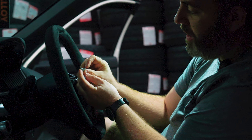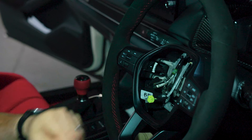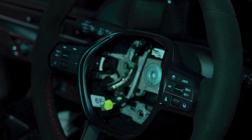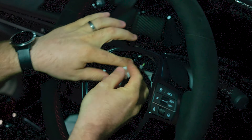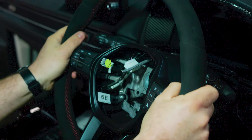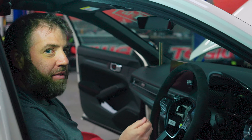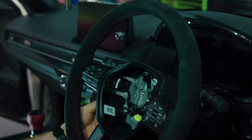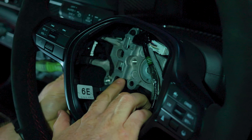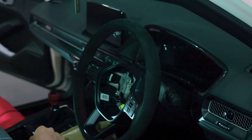We'll set the airbag down face side up. To get the airbag connector off you've just got to pull these little white tabs up and it'll come out. Inside we have a big Allen key or hex bolt and then the connector for the steering wheel clock spring — I'm going to disconnect that and leave it with the wheel. We'll undo this and as long as we leave the steering wheel straight we should be able to pull it cleanly off. Now that the airbag's off I can better show you — you can see these little springs, and we're just moving that spring and that pops the airbag out of here.